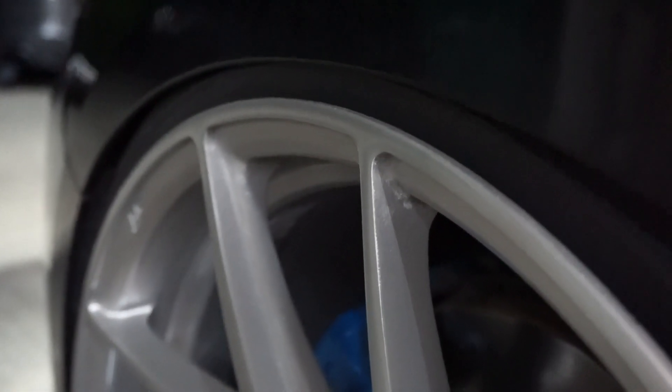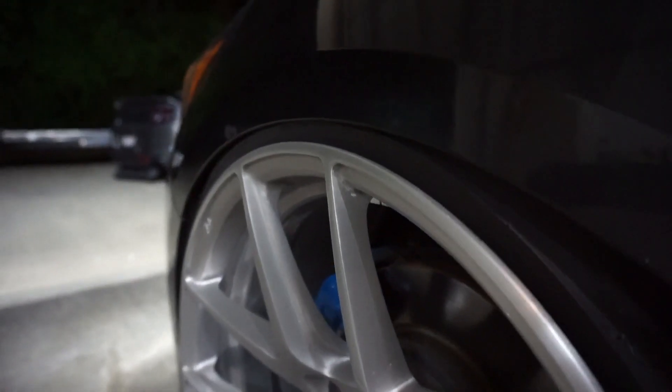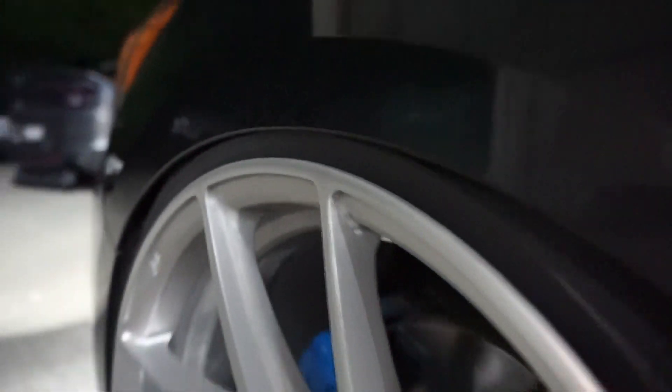So the rear is a perfect tuck — sitting on that rim like the Mustang. The only issues we're having right now is the front, and this is with the 10 millimeter spacers on here. We're going to get a fender roller and pull these fenders out a little bit. I think another thing is we need to get smaller tires, but Haley daily drives this thing so we're going to have to figure something out to get this to hit the rim. We might go a little bit more camber up front but we haven't decided just yet. It's a work in progress.